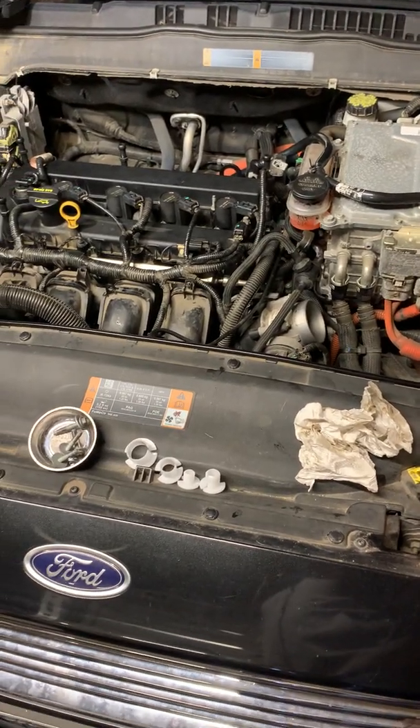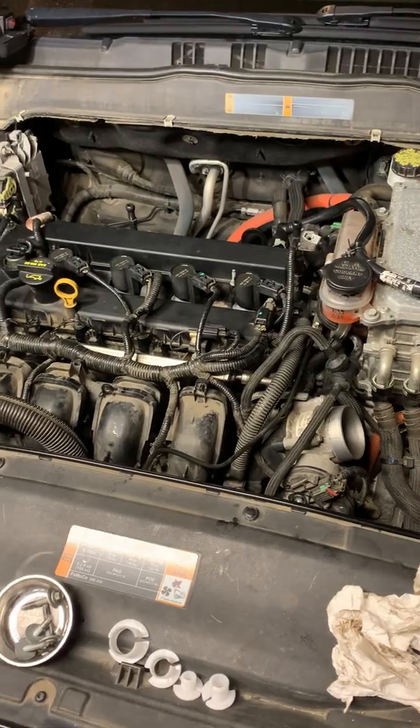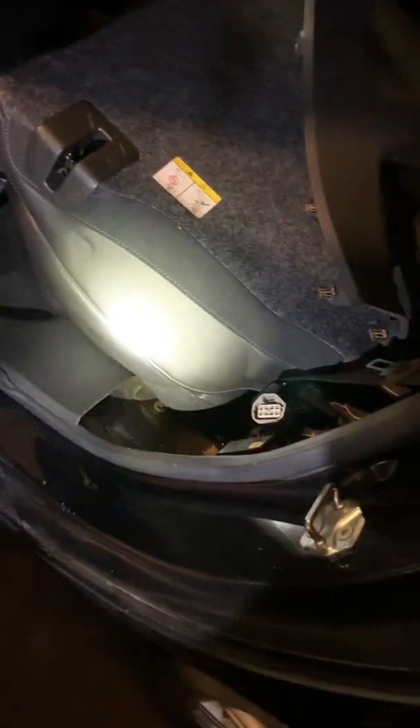So this is what you do. First off, there's a lot of controversy on the internet about what to do first. So the very first thing I did was go over here to the rear of the car, right behind the driver's seat. You're gonna pull this panel off that goes back here. And this is the fuel control module. Pull this out of here, and this essentially releases and stops the fuel pump. You gotta drop the back seat down and it's right behind that panel.